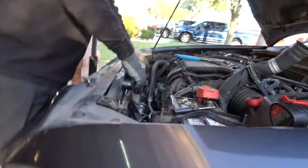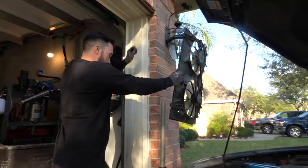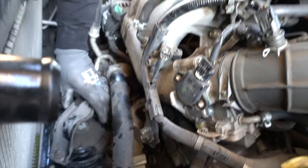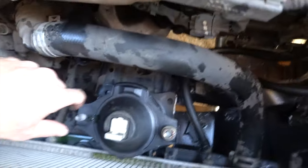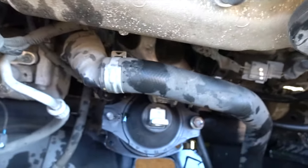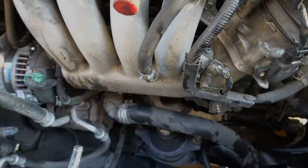It's really green coolant - should probably go get a pan. Going to lift the motor up a little bit and see if it'll let me pull this mount out. There we go - going to move this mount over. You can see the vacuum line here, going to have to move the vacuum line over. To get the new mount in you're going to have to lift the motor up - there's no room right now. Go ahead and loosen the bolts for the motor mounts anyway to do the recommended TSB motor reset. Jack up the motor until you can get it in there - slides right in, bolts right back up.